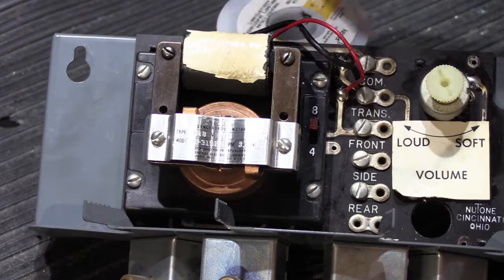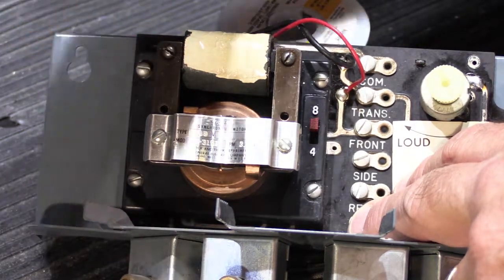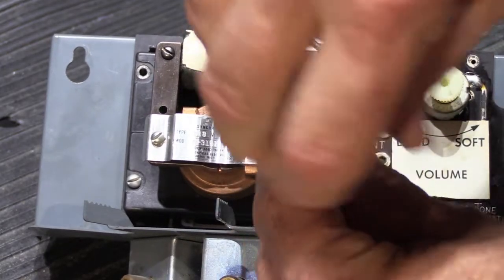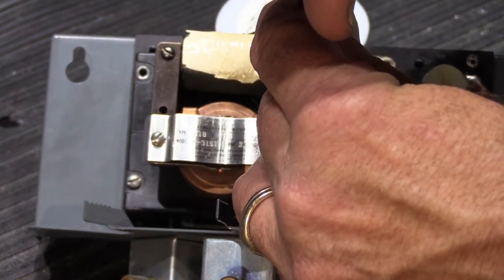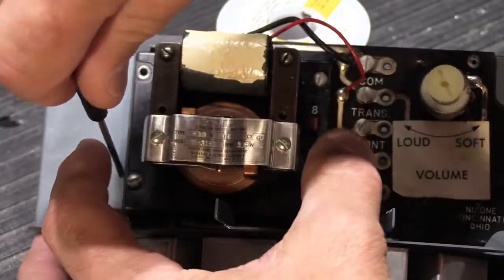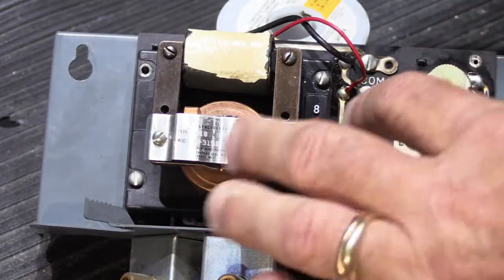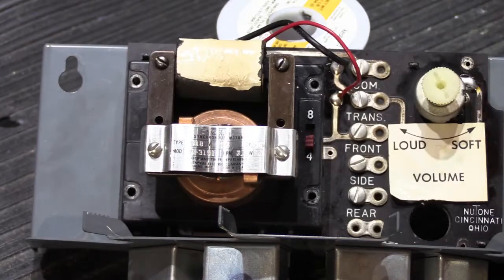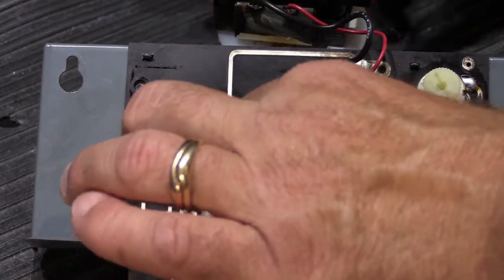The Telechron motor assembly is held in place with four machine screws. I was actually surprised when I took this one apart earlier to find the screws are rather short — I don't know if that was common on all of them or something they changed later on. They are certainly shorter than the same type of screw used on the LA's and later chimes. To take the Telechron motor assembly off the base you loosen the four screws, and once loose you can lift the motor assembly off and now have a look at the circuit board.